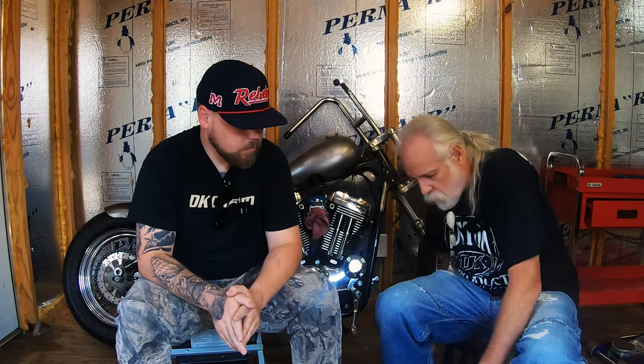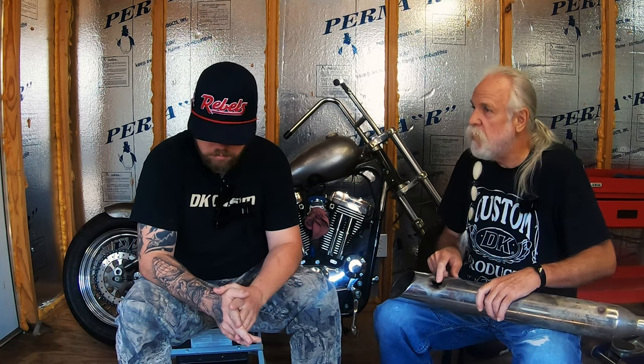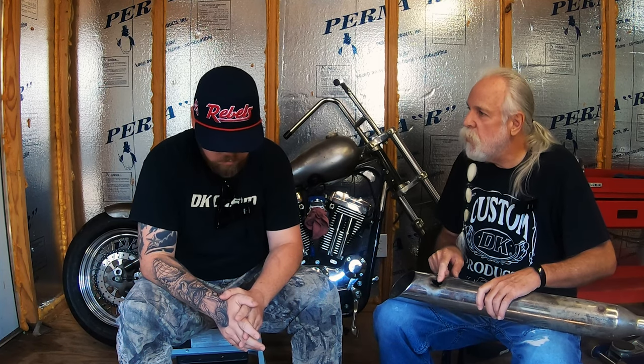There's another reason too. This muffler has been on different bikes since 2005, and it was ripped out in 2018. A few reasons it ripped out — number one is wheelies with the bottom of the Thunder Torque dragging. But another reason: even in a brand new exhaust at a Harley dealership on a bike with two miles on it, when you look inside you're going to see rust. They all rust on the inside. When you're talking about 2005 to 2018, even with a good quality pipe, it's going to have some rust and it's going to weaken.